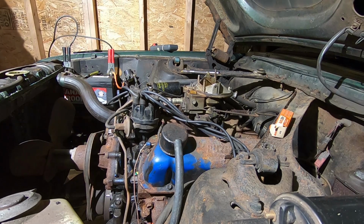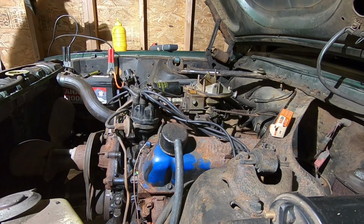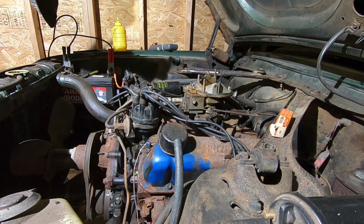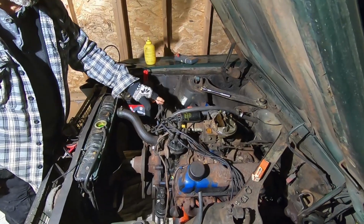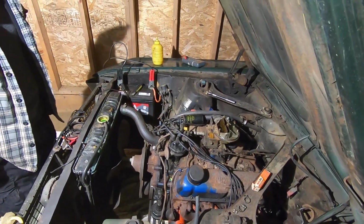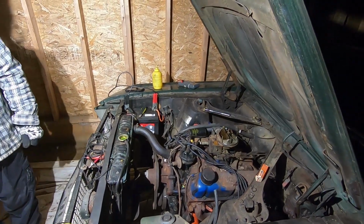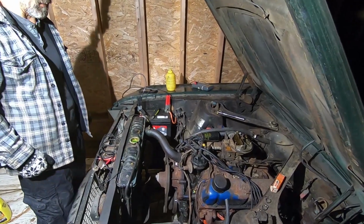There you go, people. We're gonna die of carbon monoxide poisoning. I don't care. Battery always first. Make sure you're getting fuel, clean fuel. Then coil, points. And it's freaking cold, by the way. Yeah, hands are frozen.